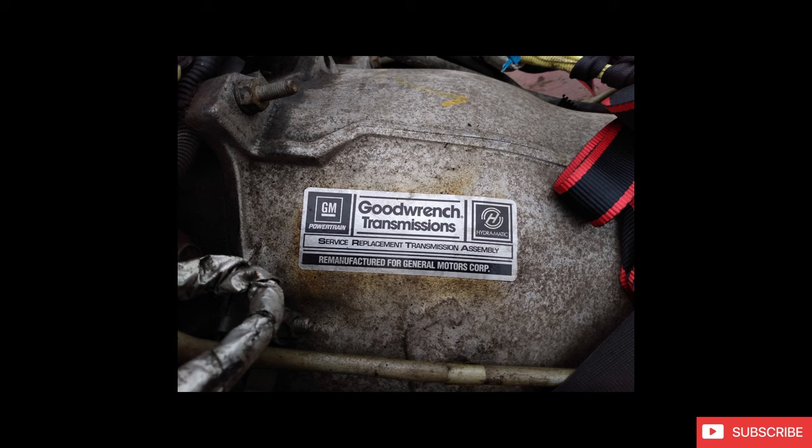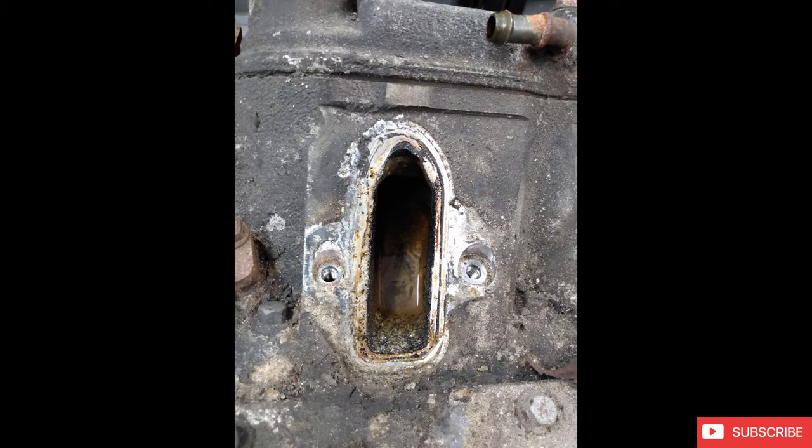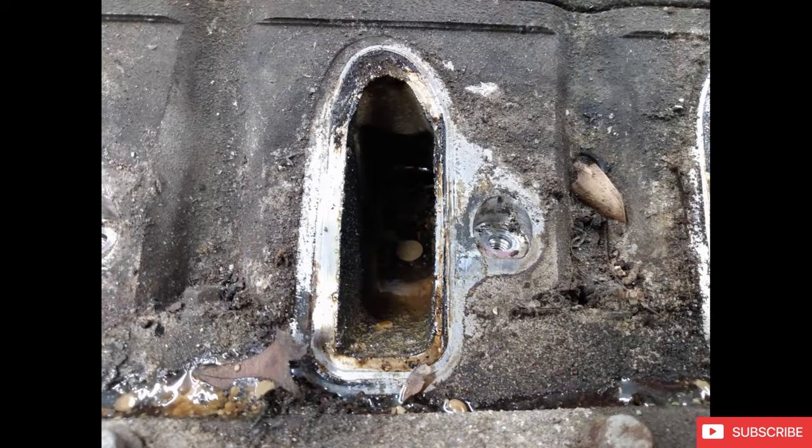But when I had pulled the intake off prior to power washing it, I found water in the intake ports of the head. So not a great start. My theory is that the guy pulled it out of the van, running and driving, and then let it sit outside for a couple of days while all the folks came on Facebook Marketplace and looked at it.